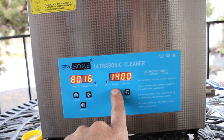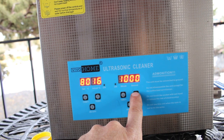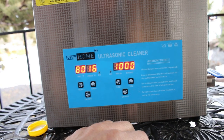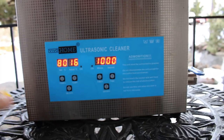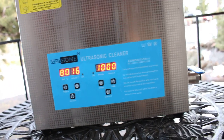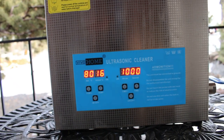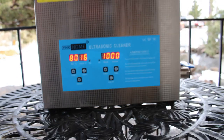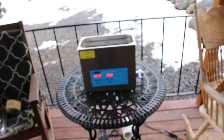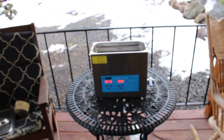Carbs usually only take about 15 minutes at most. I think we'll do 10 at first after this gets warmed up, and we'll see what they look like at 10. Because with purple power — great cleaner for degreasing — if you go much more over 10 minutes you start to really darken the casing on the carburetor. So I'll strip the carburetor down to all its little pieces and get it ready to put in the ultrasonic cleaner.